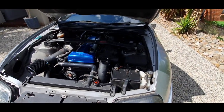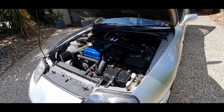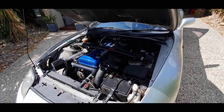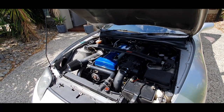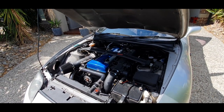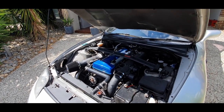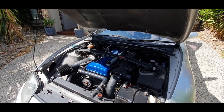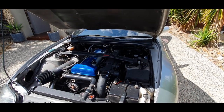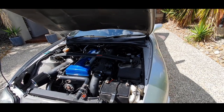Running this engine is a Haltech Elite 2000. I've only recently got that because my factory ECU died and I had to upgrade to something — so why not upgrade to the best? We did our tunes and runs on that — 334 horse at the rears like I said, because my injectors are maxing out at about 85% duty cycle. I'm in Melbourne, so when temperatures go drastically low I don't want a boost spike and go running lean. 334 with those diff gears is a lot of fun. I'll be going more power when we change the injectors, fuel rail, and lines if needed, and we're aiming to break 400 horse at the rears.